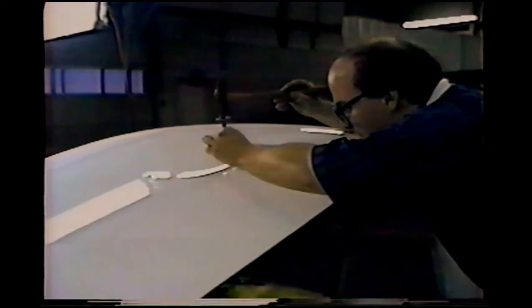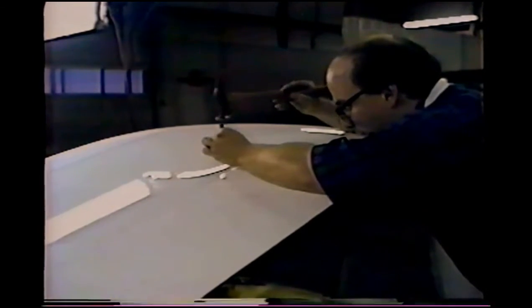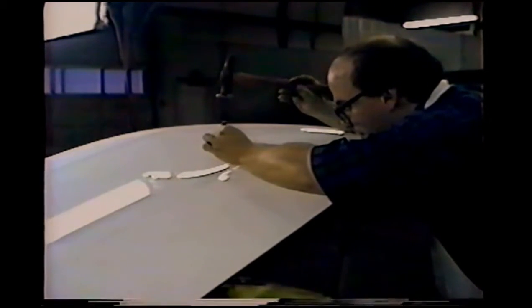Now I'm just going to tap this down with a gentle tap. Remember, you can always tap it one more time if you have to. You're almost just letting the hammer get about 2 inches above the nail set and letting gravity do the work. Don't swing it at all. Okay, now you'll notice that I'm just barely lifting the hammer above the tapper. Just letting it drop.